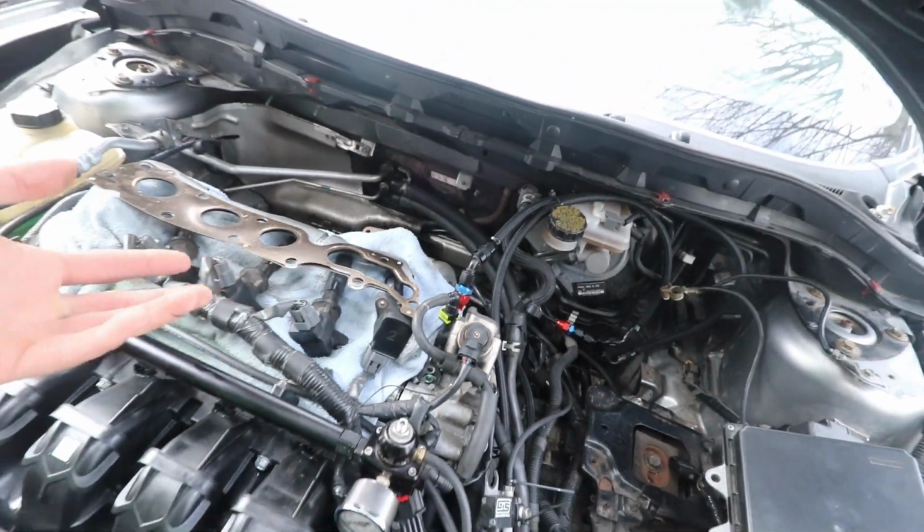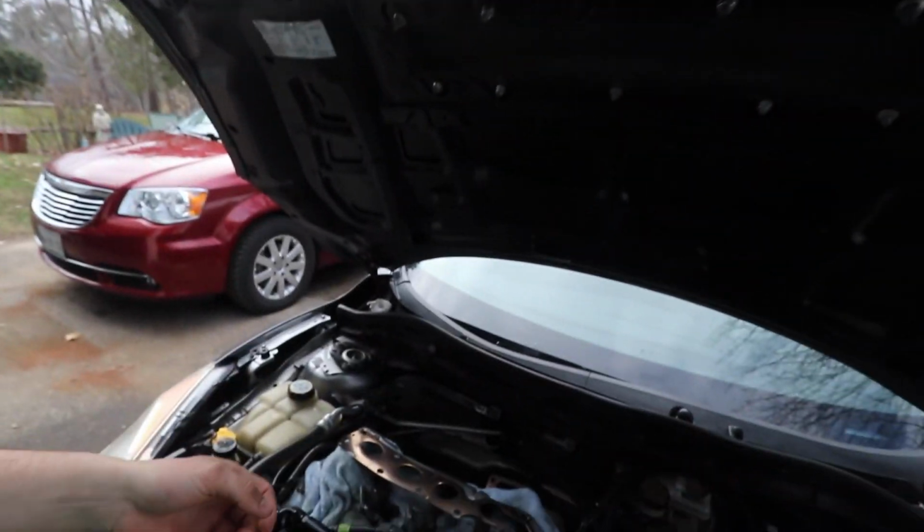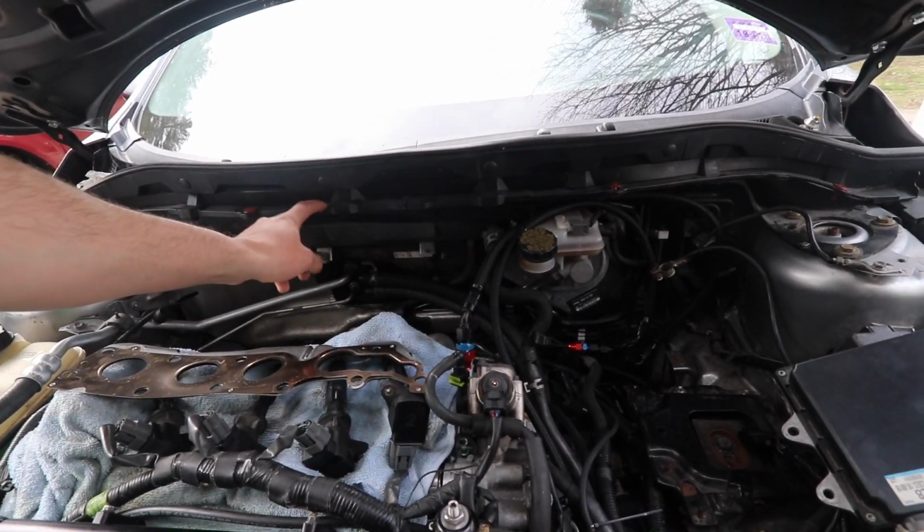It is a tight fit. That was the only major pain in the ass. I just took the studs out from the block, and it just slides up and out. I took the passenger motor mount off and slid it a little bit forward because otherwise it hits this shield right here. But that's getting welded. Shout out to Bert for welding that, thank you very much.